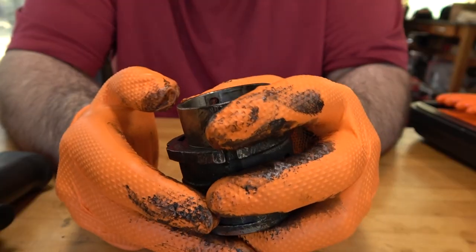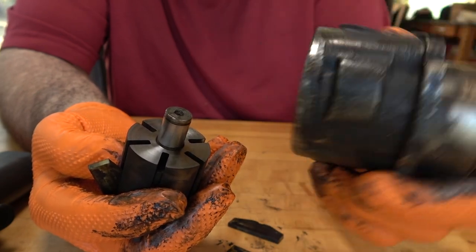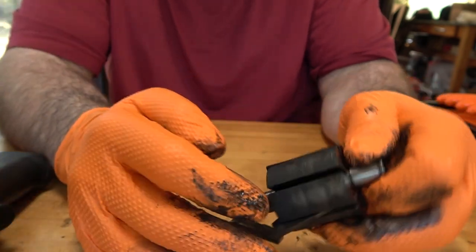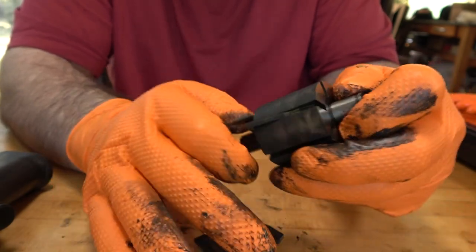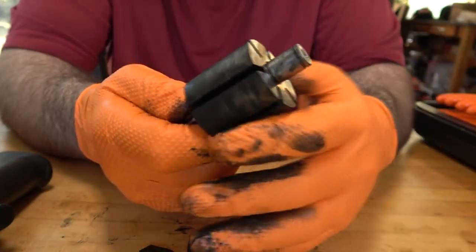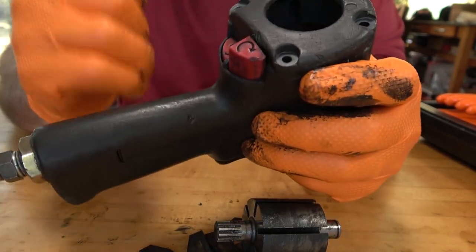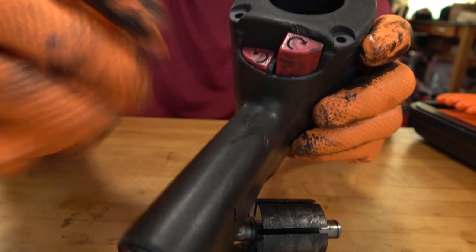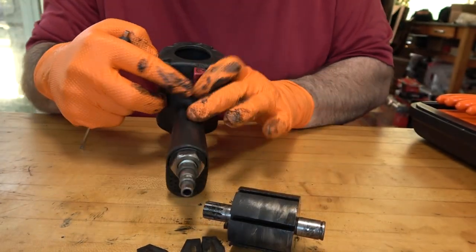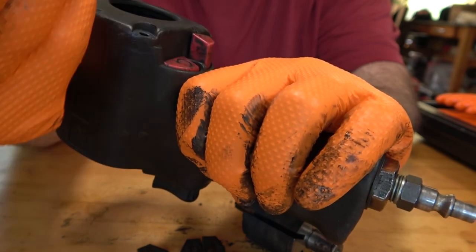Carefully lift that out. Once the snap ring is out, the rotor just falls out of its housing, and then the vanes that are in the rotor will also fall out easily. On this particular model there are six rotor vanes — some models have seven. Next we pull the selectors out; they're held in with little tabs that face the center line.